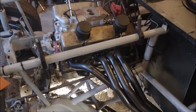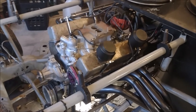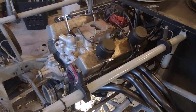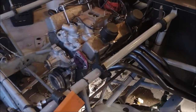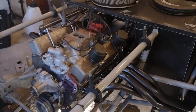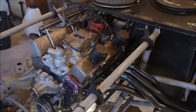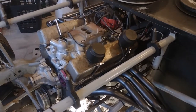The engine is a 358 cubic inch small block Chevy. There's really nothing super special about the engines we run in the B-Modifieds — that's one of the things that separates this car from an A-Mod. A-Mods have a lot fewer restrictions on what you can do with the engine. This one would normally have a two-barrel carburetor on top of it, which has been removed for rebuilding. This thing probably pushes about 400 horsepower.